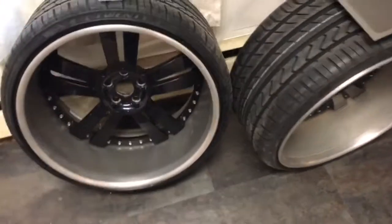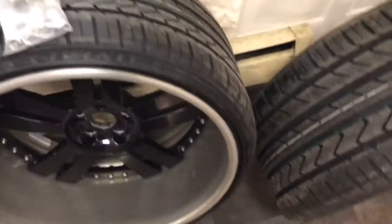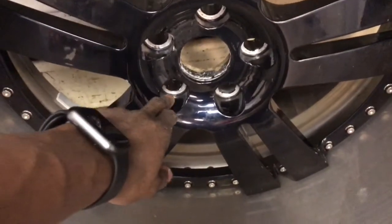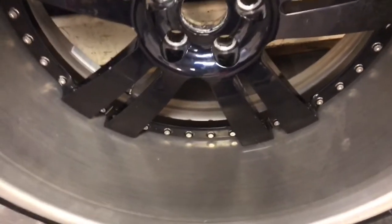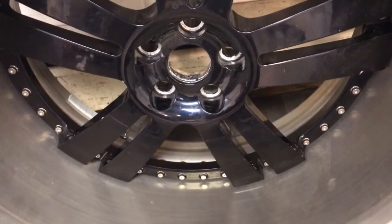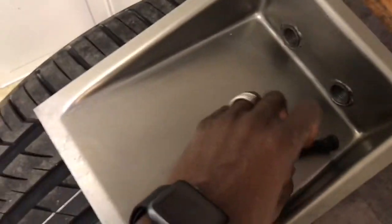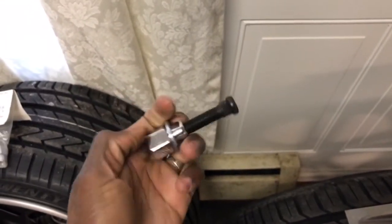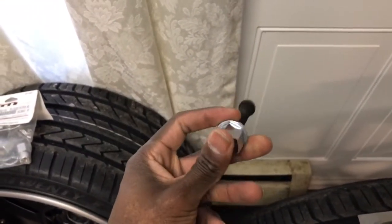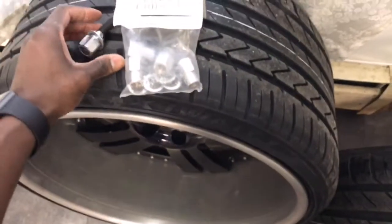Some other things that came in today: my bolts. With HREs, they're special order. The guy I got these from had them on a Range Rover, and the way the lugs bolt up is different from normal lugs. So I had to get what's called a mag bolt — it has a washer and sinks into the hole to lock everything in. I found some with the correct thread count: 7/16 by 20 from Summit Racing.